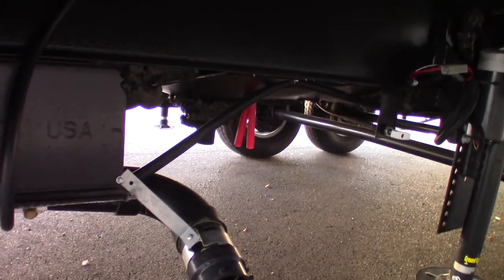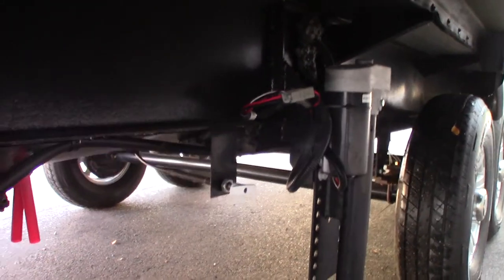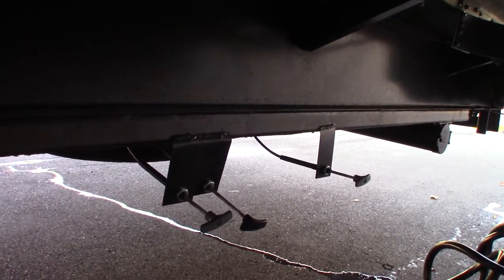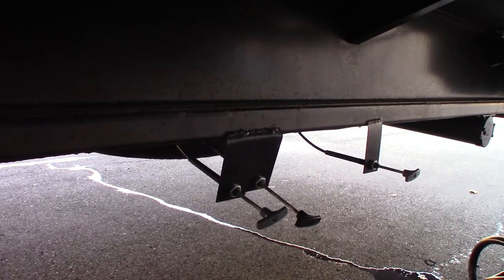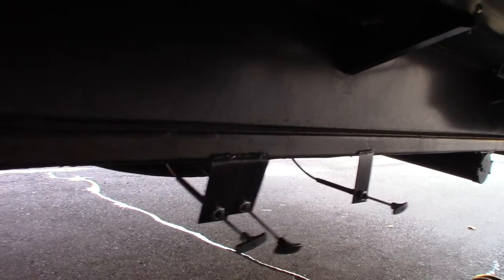This dump connection is for these two valves here. This connection appears to be for fresh water — and yes, it says right on the sticker. Then you have another connection here. You also have three dump valves: the black valve is for the rear toilet, the gray valve is for the vanity in the bathroom, and then another one which is probably for the outside sink. Remember, before you flush the black tanks always open the valve first.